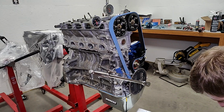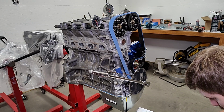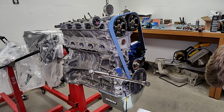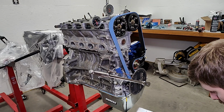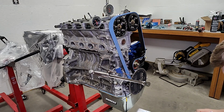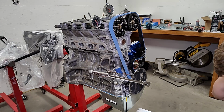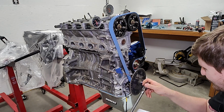So you hear all the time that you need to degree your cam. And what Brandon's just shown is, yes, you need to degree your cam, because what is listed by the keyway as being 0 actually isn't 0. My exhaust is at 110.75 and it needs to be 112. My intake is at 95 and it needs to be 106. They are not where they need to be.